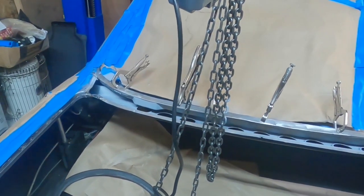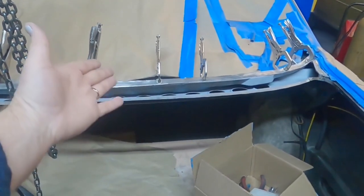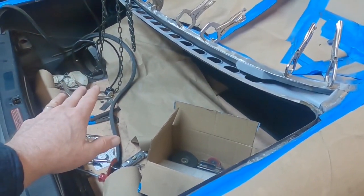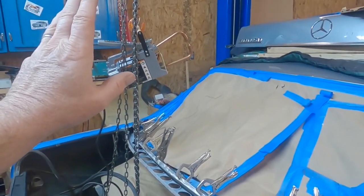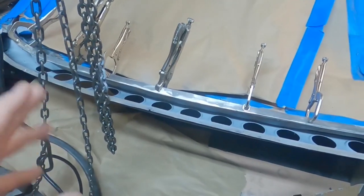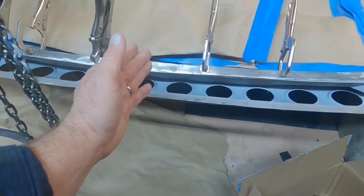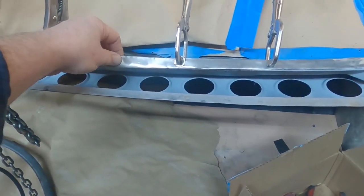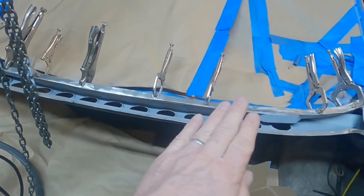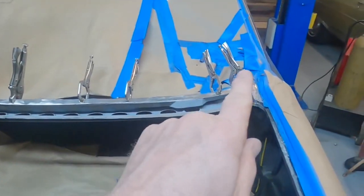All right, so we had to take a Thanksgiving break there — took some time off from working on cars and from the regular job as well. For those who don't know, yes I do in fact have a regular job. So let me get my tools out of the trunk, get the little step stool in here, and then we'll start to lower our spot welder into place. The first couple of spot welds I'll come in close to one of these clamps, one on either side, then take that clamp off and come in from there. We don't want any ripples — no ripples, dead smooth all the way across — so we'll apply a little redneck strategy to get a nice smooth result.